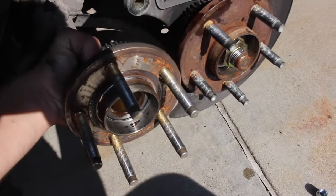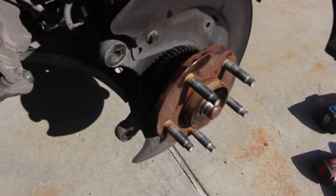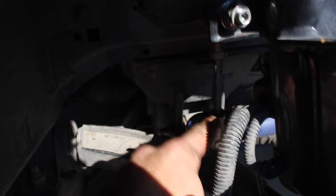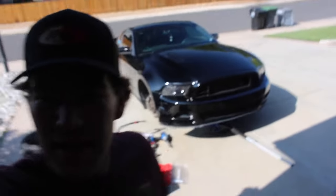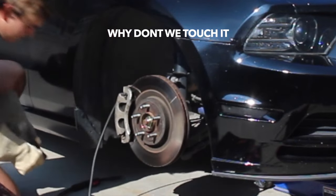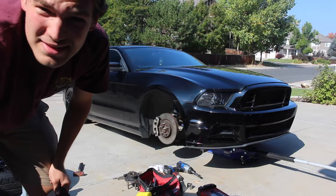Finally got the stock hubs back on. You can really see the difference of how long they are — yeah, that wasn't right when using stock size wheels, so now that I'm not using the 305s these will work a lot better. The old hub is back in, and my sway bar end link — I don't know if you guys can see it — it keeps coming undone here at the bottom. So what I'm going to do is put a tack right there and a tack right there, do the same on the other side. I'm hoping that stops it from breaking all the time. I'll tack that real fast and then we can start putting everything back together. This side is done — let's get her back together.